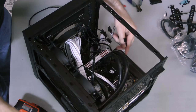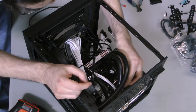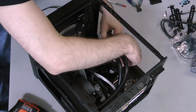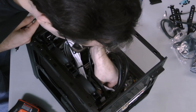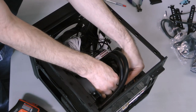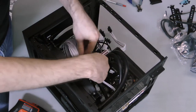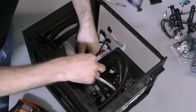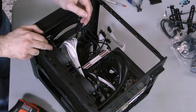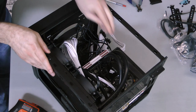At this point, I realized I forgot to connect the front intake fan, but now is as good a time as any to connect it to the remaining fan header on the motherboard. Finally, connect the included USB cable to the water block and then to an open USB header on the motherboard. Since the H100i is a tight fit, be sure to spin the radiator fans with your fingers to check for obstructions and make sure no cables are going to get into the blades or rub against the fan hubs.